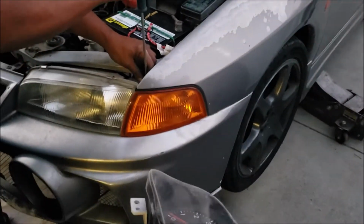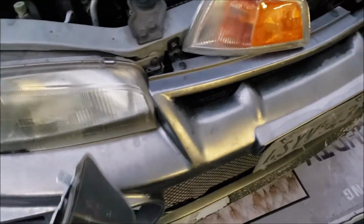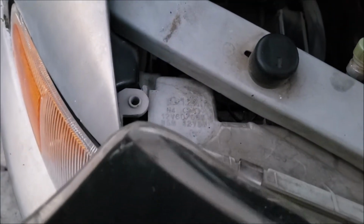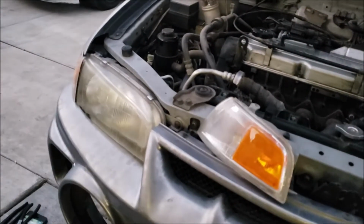And then we did just notice that he is missing, or I think when my brother got into that little fender bender, he broke the JDM side marker, so he's actually running the Mirage side marker. These are also original Evo 4 headlights. They do have a little driving lamp or city light inside. Unfortunately, it looks like the plastic lens is cracked right around there. And also all the little tabs are broken on it. And the little retainer or tab that the side marker bolts onto is also cracked as well. But this side's still okay. So, yeah, that one actually looks clean, and that one probably just got some condensation in it as well from the cracks on it.